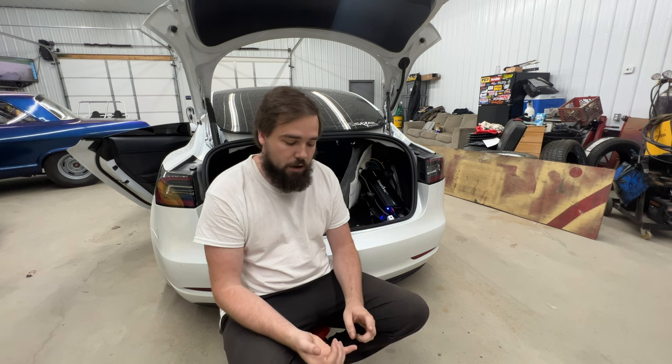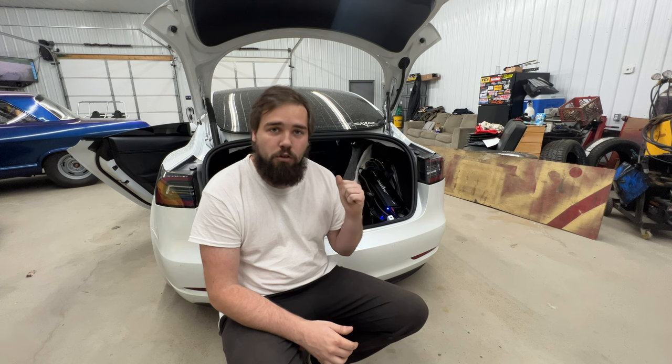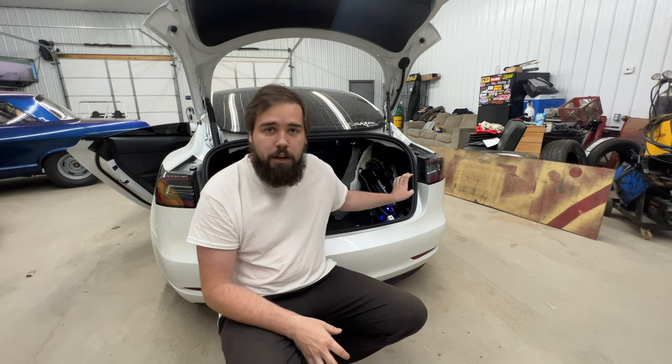The issue we're having is I run my air compressor for the air ride system, and this amplifier, off of the main outputs from the DC to DC converter, rather than running everything off the 12 volt battery, because it's very small and you can drain it. I think the battery management system in this car will know that there's an excessive draw on that battery, just from research I've done. So people say to run it right off the DC to DC converter because the battery management system isn't metered yet. On the 350 watt amplifier I had in here before and the air compressor, I never had any issues, but now I'm running a bigger audio amplifier, and it also has bigger capacitors.